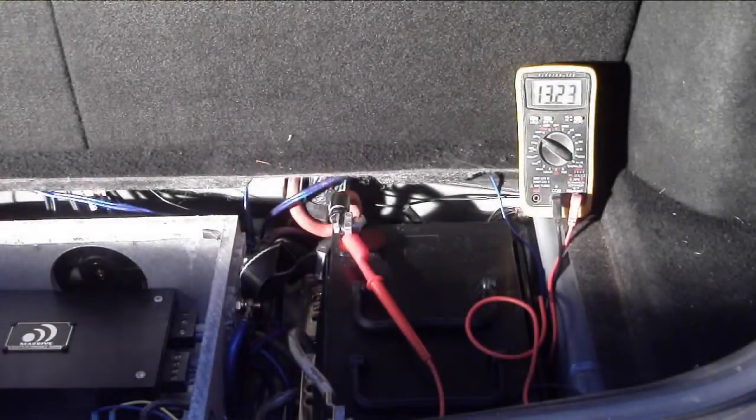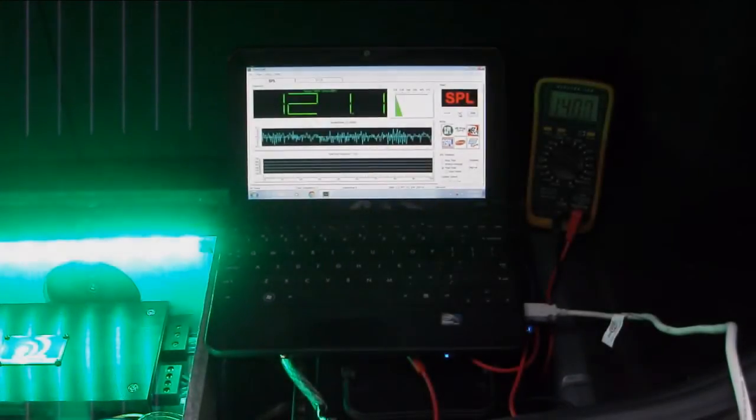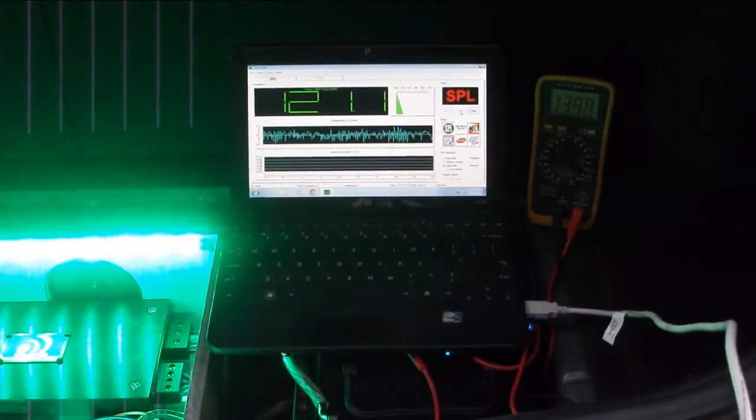Okay, so we've got the Model 3000 installed in the car, and it looks like the resting voltage is sitting at right around 13.2 volts. It's fluctuating but staying around 13 volts — that's great. I think we need to go ahead and start it up, see where she's at with running voltage, and run Term Lab on her and start comparing notes. With the car running, the voltage is settling around 14 volts, which is just fine — that's where we want to see it.